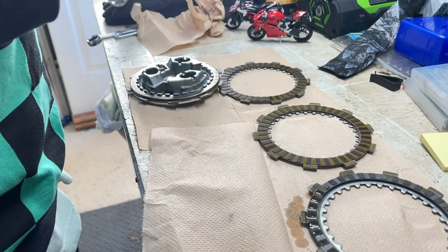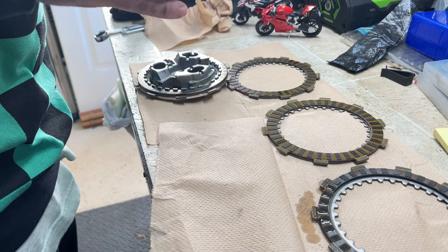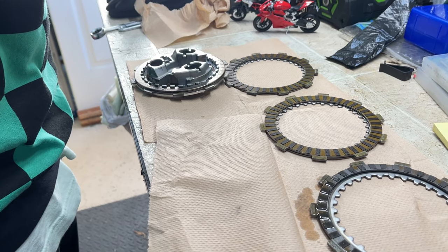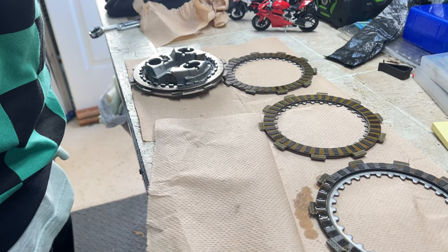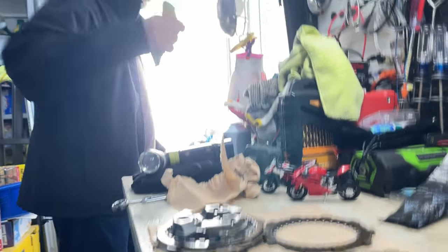Getting in trouble. Oh shit. Changing out that's the clutch. Too, huh? Smells like oil. So I think the clutch materials are just wearing unevenly because of those clutch springs at high RPMs. Yeah. Prime example right here.